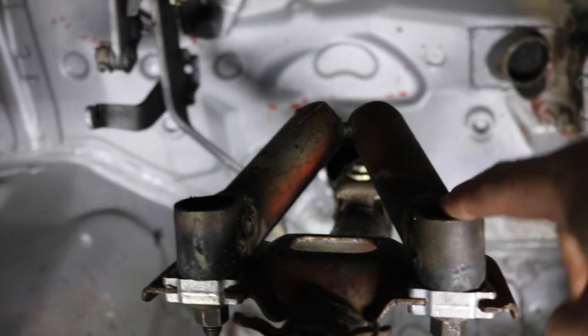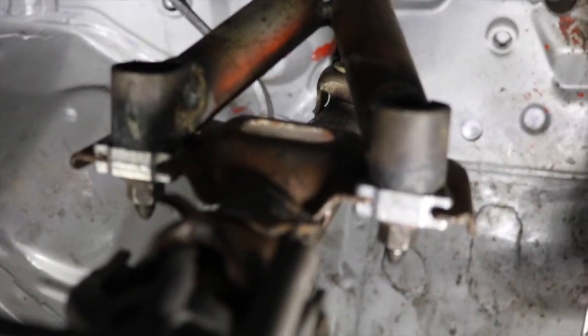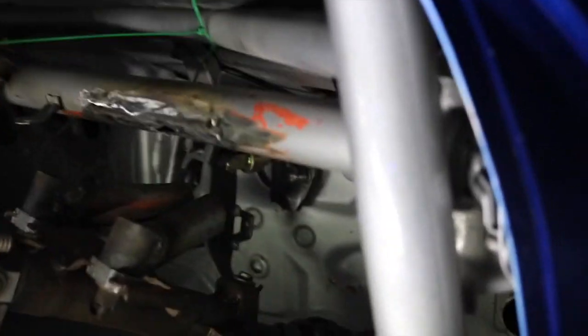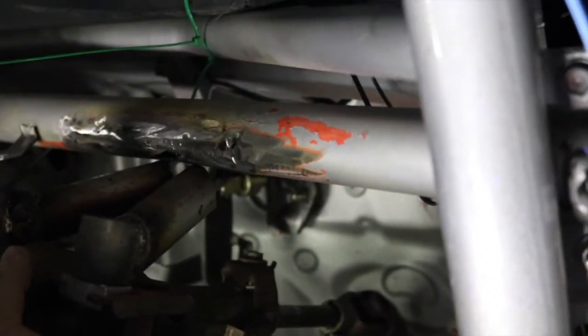It's raining outside, so I went ahead and chopped off that bracket I had tack welded, and I created this little thing right here. Basically I welded some nuts inside the tubing and then I made this cross tubing just to make it structurally sound. It's got bolts underneath so this piece can come off. Now I just need to notch it in back — I gotta notch it like this because it's gonna go right here. It's really heavy. Basically I gotta notch it so it fits in there — you can kinda get a mental idea.